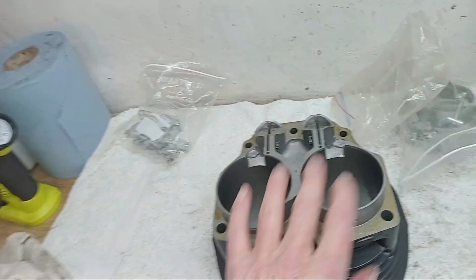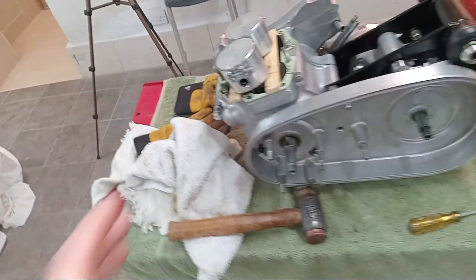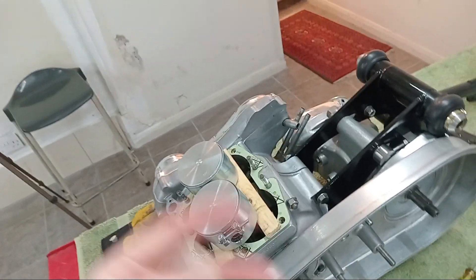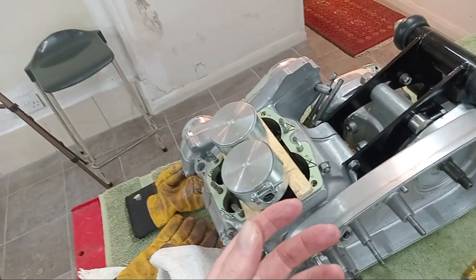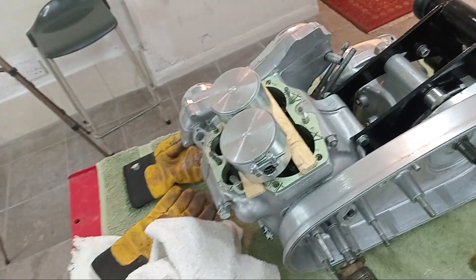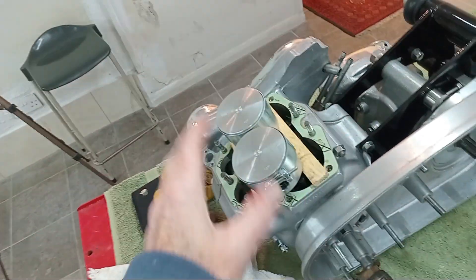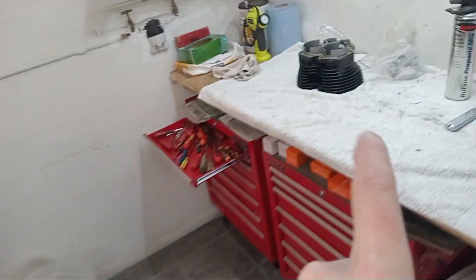I'm probably going to wipe most of the oil off before we go. On other engines, especially more modern engines, they have different piston rings and the way the honing and reboring goes, basically as soon as they're in they're done. But with older bikes they do need this bedding-in period, this running-in period. That's why new engines you don't generally run them in - because they're already done. But these are rebored and honed in a different way.